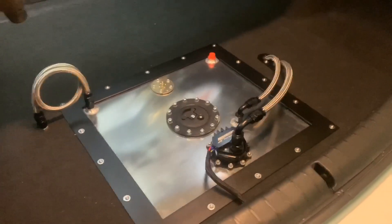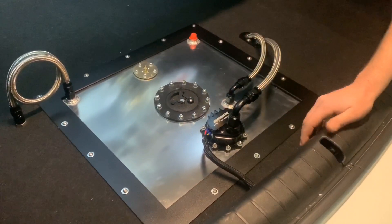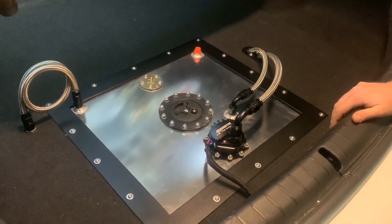Hey guys, I'm Jordan, I'm Lex's husband. I'm going to go through some of the details on the fuel system, show a couple videos along the way of setting it up, and then go through some of the data that made the decision of why we went this route versus other options. The fuel pump itself is Aeromotive's five gallon per minute brushless gear pump with a built-in variable speed controller, sitting in a 15-gallon fuel cell. The rails are fed with a dash-10 braided PTFE line with a dash-8 return. The fuel filter is on the bottom side of the car in front of the cradle, and the fuel pressure regulator is mounted in the cabin air filter box up front in the engine bay. This fuel system should be capable of supporting 1800 horsepower in a forced induction E85 setup. Being an in-tank pump that's relatively quiet with a variable speed controller should make it really ideal for a street and strip car application.